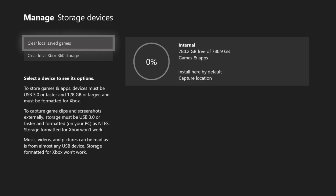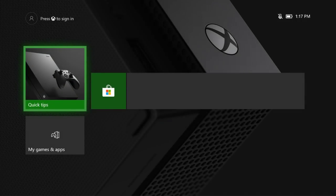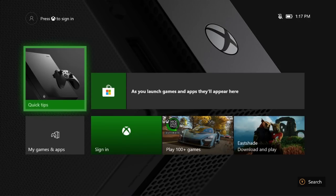The point is we now have a one terabyte solid state drive installed and working just fine on this Xbox One console. The Xbox One is upgraded and we're good to go. However, you might notice that whenever you turn on your Xbox using energy saving mode it's showing a black screen with no boot animation. As mentioned earlier, the boot anim file does not come bundled with the offline system update. There are two ways to fix that: wait for an update through Xbox Live to apply it automatically, or manually copy over that file. If this doesn't bug you, you are done — congratulations.